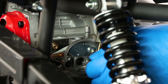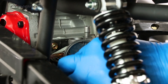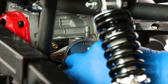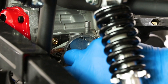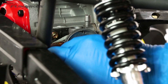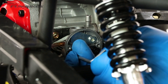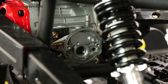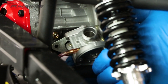Using the 4mm Allen key, undo the two bolts holding the carburettor on. These will be tight as it needs to be an airtight seal. Loosen off both sides first to avoid damage to the carburettor, and then fully undo the bolts and remove them from the carb. Carefully remove the carburettor from the V-block.